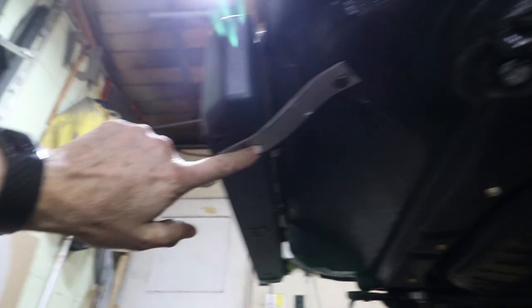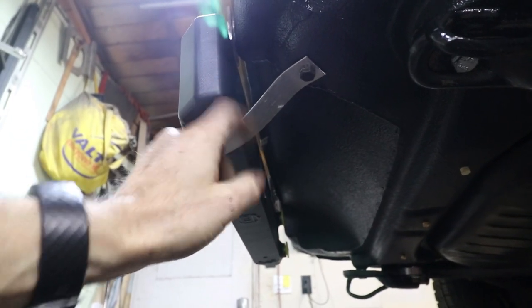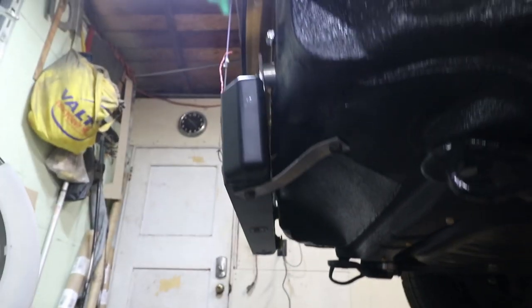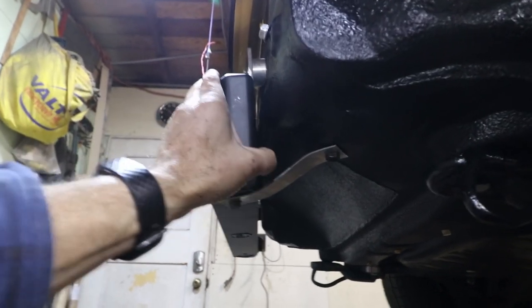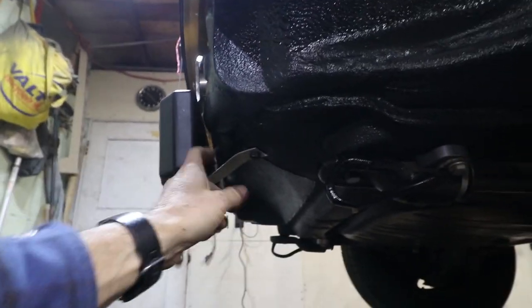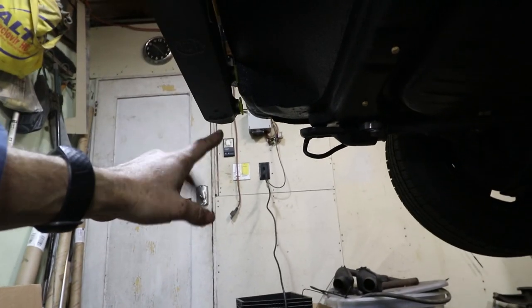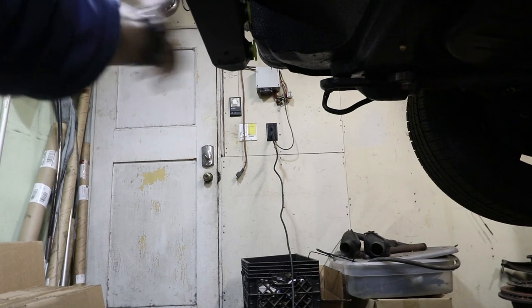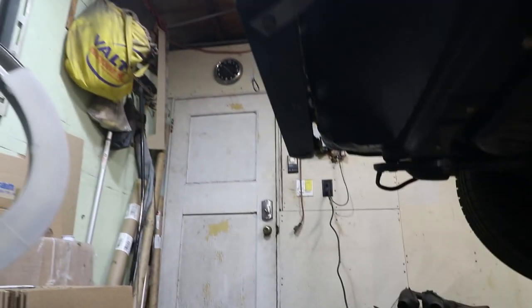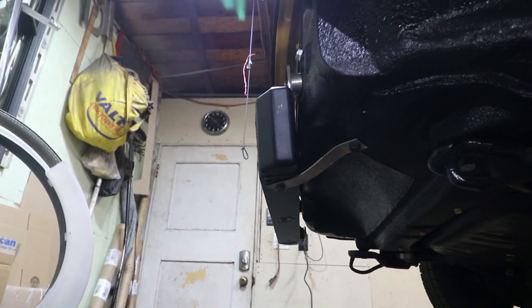Yeah, I just found this strap of aluminum, and it's pretty thin. It's like, I don't know, .050 probably. And it's really strengthened this oil cooler. Now you can whack it, and even though it's a thin piece, it really strengthens it. I'm probably not gonna put one on the other side because it's not necessary. Even if I whack this, it doesn't vibrate very much. The deflections are way down. So that's how it's gonna be.